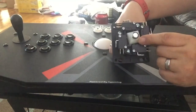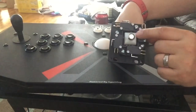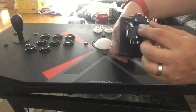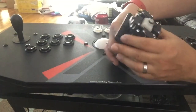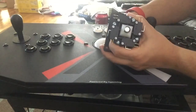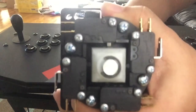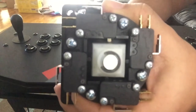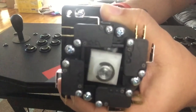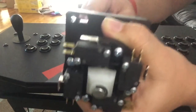On the inside of the IL stick, it's got this square polyurethane-type grommet — or actuator, whatever you want to call it. That's a big difference according to everyone I've heard, compared to the HAP ones. If you notice how close that grommet is to actuating those switches — I'm just doing a very slight movement and it's hitting. Now if I'm doing a diagonal movement, you can see it is definitely hitting both of those switches. So if I'm doing a Hadouken motion, you can see it's hitting all those switches very nicely.